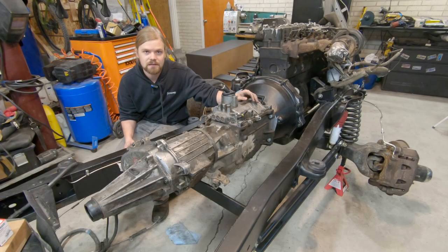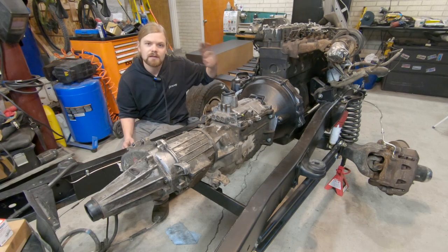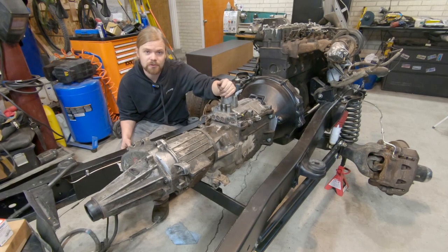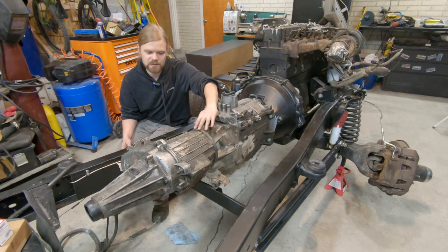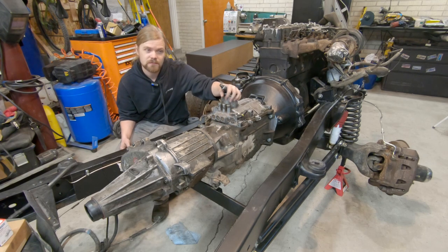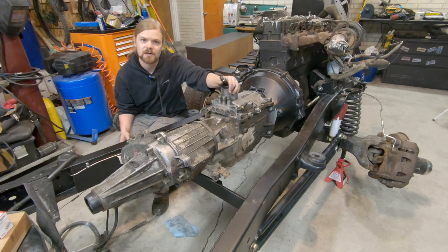Here she is. Killer dowel pin done, got it all sealed up front and rear, got a clutch in it, got a transmission and transfer case on it. This should be permanently in the chassis now, which feels like a pretty big step of progress. I do still need to make some minor adjustments — the number of spacers under the transmission need to be adjusted slightly to get the angles right — but other than really minor adjustments, this is a pretty big milestone. There isn't a whole lot more this thing needs before the body can go back on it. I hope you enjoyed this video, thank you for hanging out with me in my garage. Subscribe and stick around if you want to see the next one.